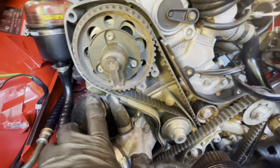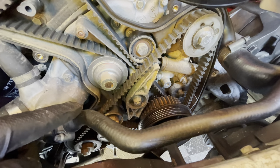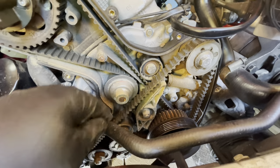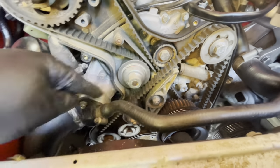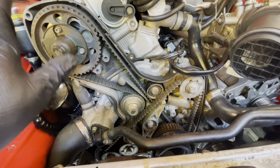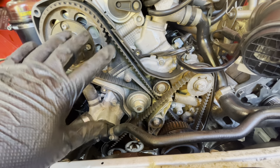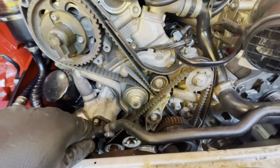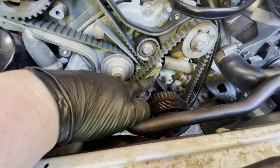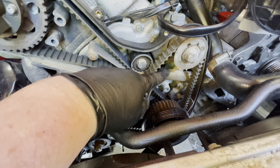Let's have a look at this — in essence it's not too bad, just very dirty. I'm pretty sure the squeaking we heard last time we started this motor was one of these bearings that gave out — either this one or the tensioner down there. I'm going to methodically take this apart. One thing that's different about a 968 is this very different automatic tensioner that keeps the belt in tension — that's unique to a 968.